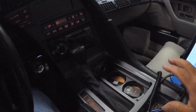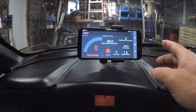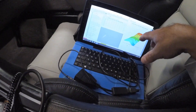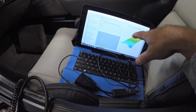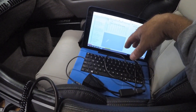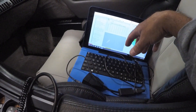Basically what you need to know, other than the cables, is the software. You've got ALDL Droid, which is Android software you can download from the App Store — I think it's about $20. You can also go to Tuner Pro, which is Windows-based and free. There's Tuner Pro and Tuner Pro real-time. Real-time is free but you'll get a little ad at the beginning, and you can disable that ad by paying a fee — I think it's $39 for a lifetime license.